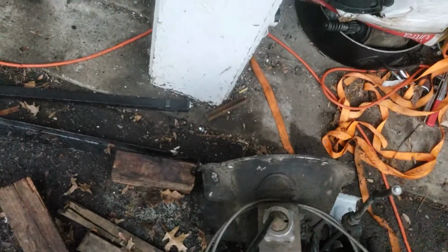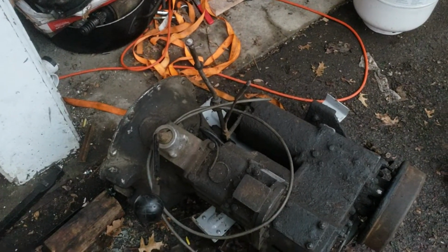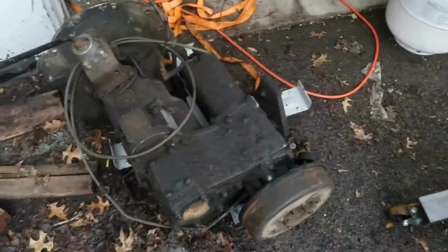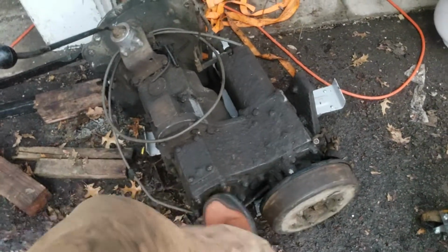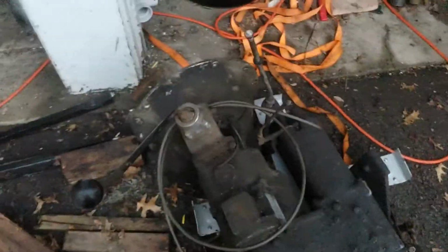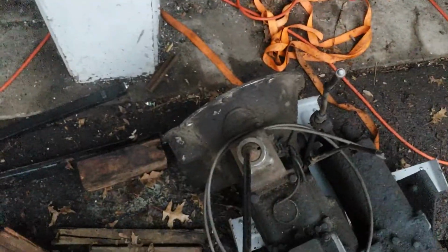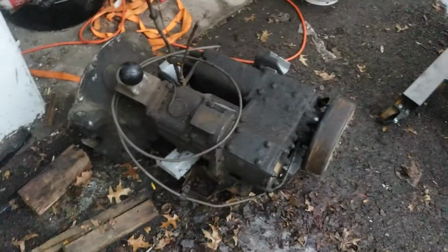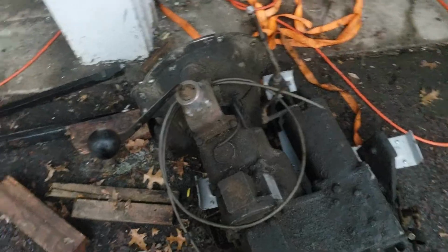I've also got another gearbox that is coming to me for free. I mean, you don't turn down a free gearbox, but it's actually Suffix B, so it's got the lower range. The low range in the Suffix B box is lower than this box, and apparently when you put the Suffix B gearbox on here with the Series 3 box, you get about half speed in first and second. I'm not sure about third, for some real crawling action going. So that would be fun if I ever got the 109 I'd like. That'd be good for that. But I don't know, for now just kind of store this thing and get it over with.